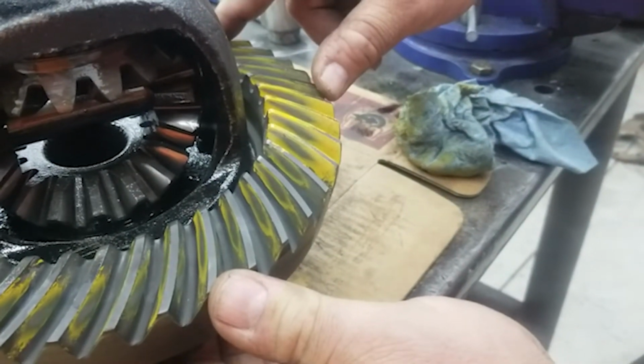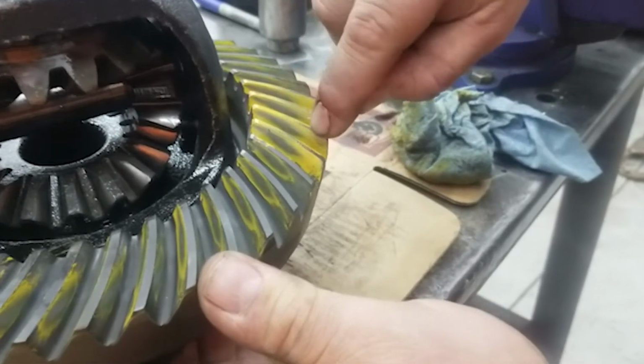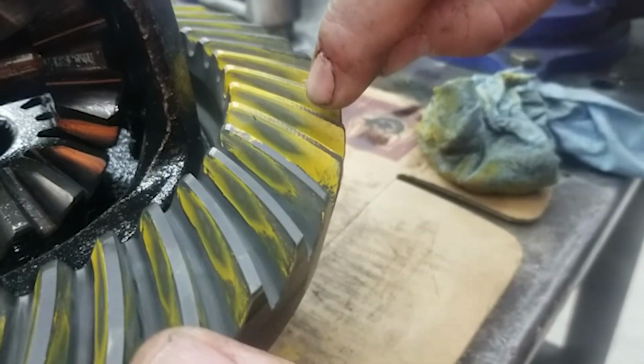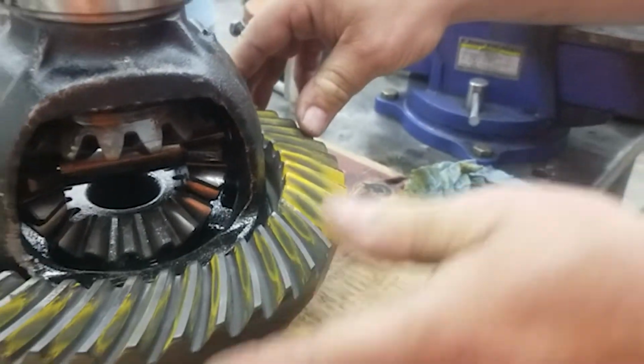It's kind of cutting off the top of our pattern, so it's hard to tell. But you're starting to get that round edge right over here. Got it. And you're not quite over here. So at this point, you want to get your backlash when you're this close. You want to get your backlash dead on, because that will change the pattern just slightly. And then we will probably take out maybe 2 or 3 thousandths of an inch.